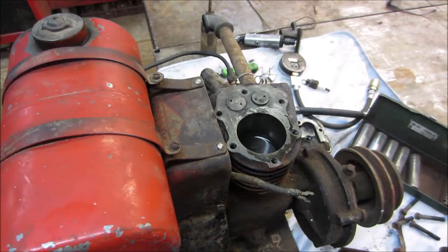Let's go tear it apart a little bit and start looking into it. Let's get those valves out of it and see what they look like. And maybe that whole valve area has an issue. Yeah, remember too, the oil that we took out of this was like molasses. And I have a feeling somebody put really thick, probably gear oil in it to keep it running, and then I think it just lost so much compression it died. That's probably why it had such a thick oil in it. All right, I'm gonna sip my coffee and then we'll do a teardown.